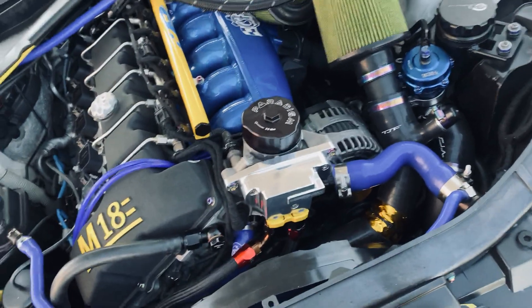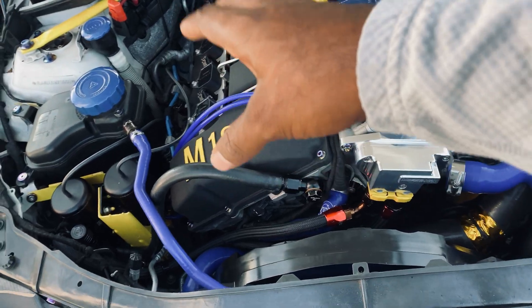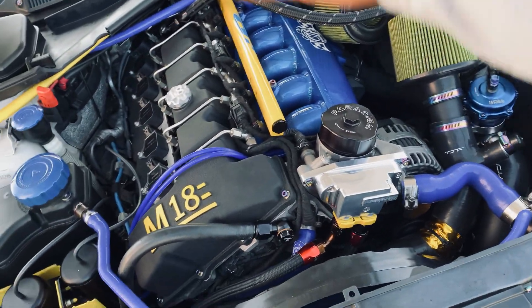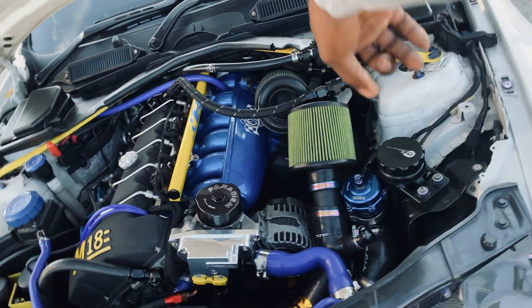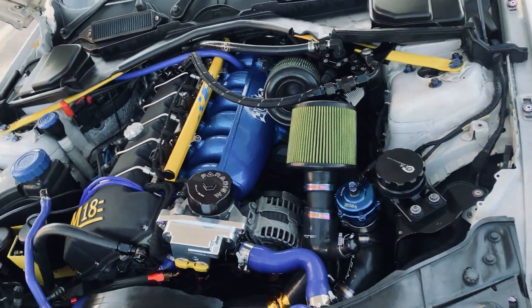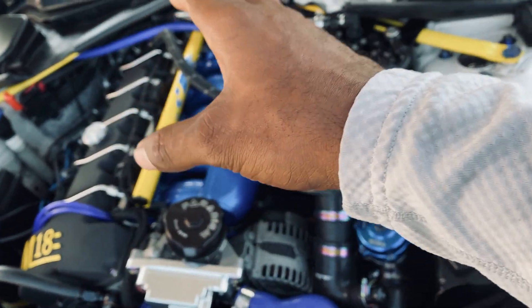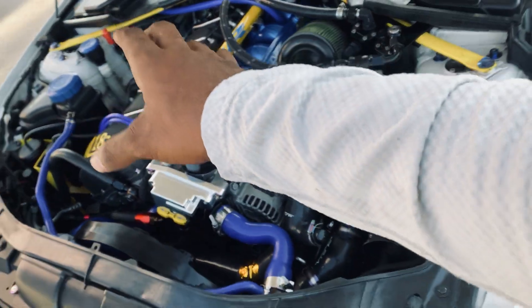I was just going over the B58 setup and I have it all installed. I also have the B58 plugs installed and the car is running perfectly fine now, no more smoking issues in boost, which the check valve has rectified. You need to have your PCV system set up as close to OEM as possible in order to have your system running properly.